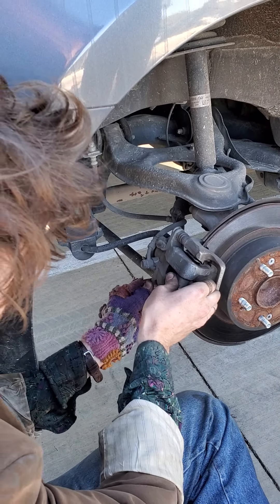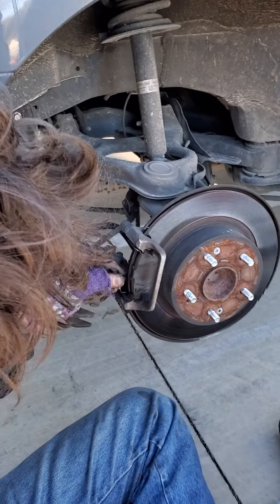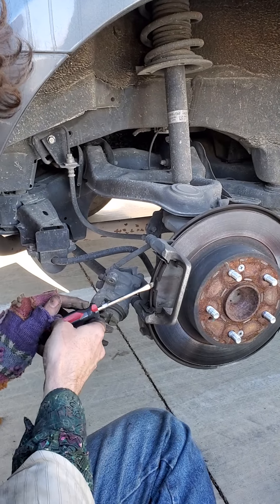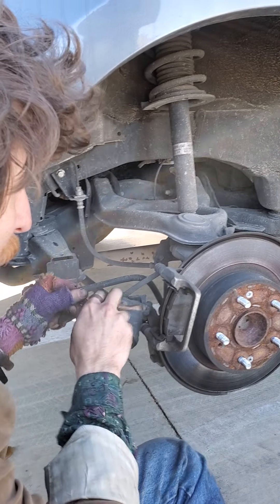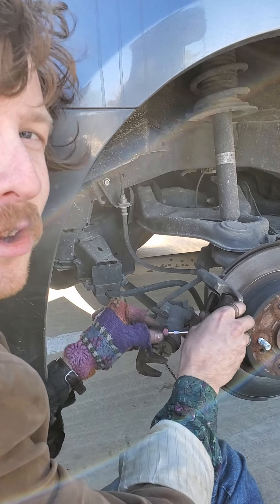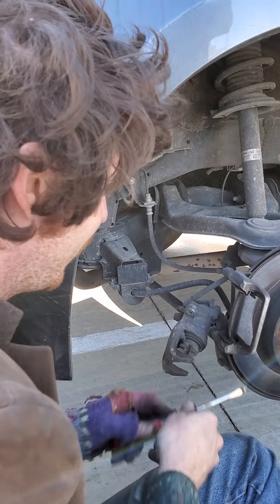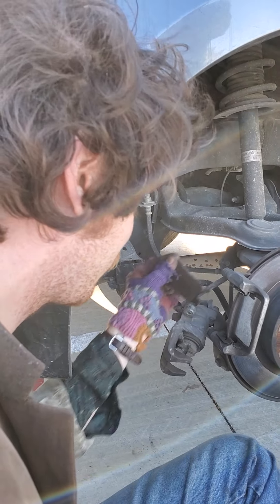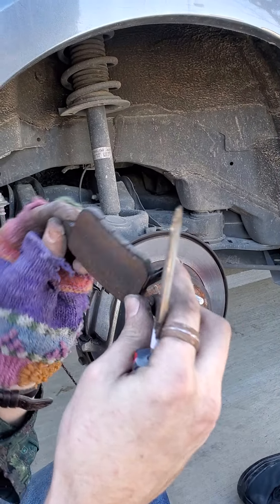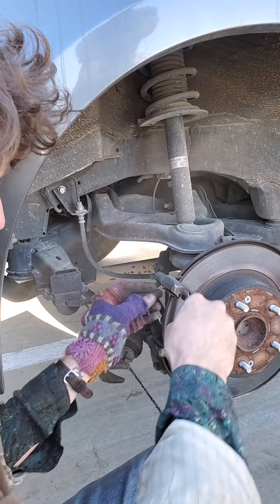Here you've got a little clamp that keeps the brake pads in place. You're gonna want to pop these out — you don't really need a screwdriver but it's kind of fun using tools. You could do it with your hands but you've got a screwdriver, so just pop them out. These ones are pretty worn — I bet this is where that awful squealing sound was coming from.